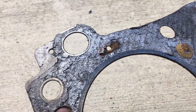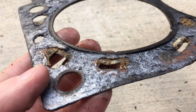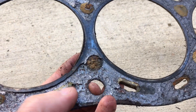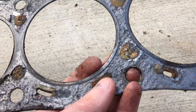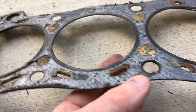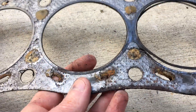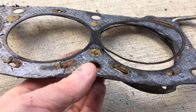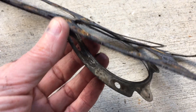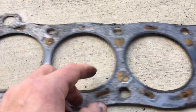You can see — to me that looks like evidence of gasket sealer being used on the passageways here in the block itself. Some of the passageways were completely covered over by this weird graphite material that came off in sheets. I've never used head gasket sealer myself, but I'm assuming the previous people I bought the truck from, who were a little sketchy, would have no qualms about dumping that stuff in.